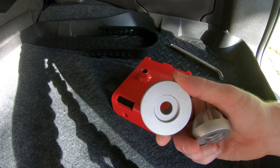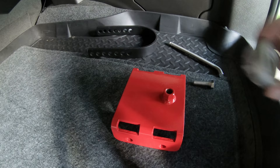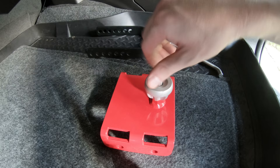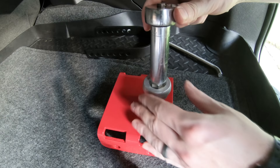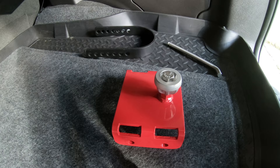These are your two ball sizes that are supposed to work with your trailer, and they do get installed right on top of this thing here. I'm gonna go check on my trailer and see which one fits best. It is the smaller one that fits that trailer over there, and this is pretty much the only thing I'm gonna use it on. So you put it on here, per the drawings you tighten this guy down — use a three-quarter inch wrench or a crescent wrench to snug that down on there. So that's all the assembly we do.